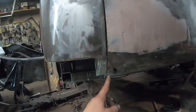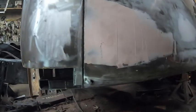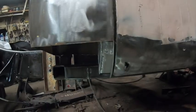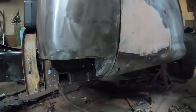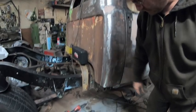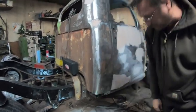That's probably a perfect gap there, but we want it to go a little bit more — we can always tap it. We'll pump it a little further because when the pressure comes back it'll spring back, so we go slightly past. That's getting pretty damn good — a pretty good gap. Now we just have to weld, weld, weld — open the door, weld, weld inside. We'll weld about five different places and hopefully that'll keep it. If it doesn't, we can put the cab corner in and add bracing in the back, but I think that will work.